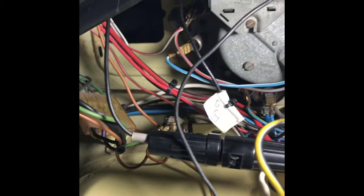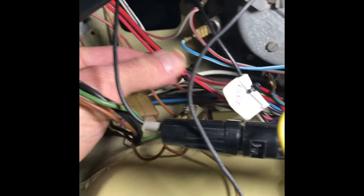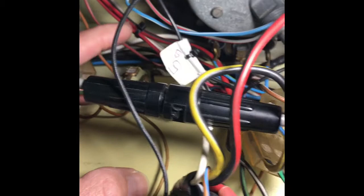I have tried to keep all of my wires organized by system, tucked together with a zip tie. These are the wires for the light switch. The first wire we're going to address is this gray wire, and that gray wire is coming from terminal 58, connecting to fuse number two at the bottom of your fuse box — that will be this wire right here. You can route it in a way where you can have it hidden in the back of your fuse box.